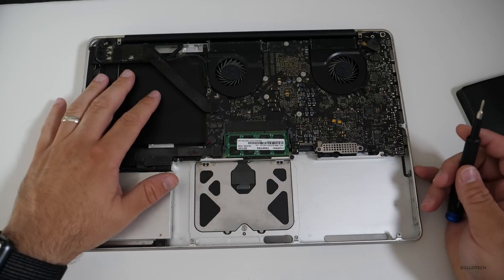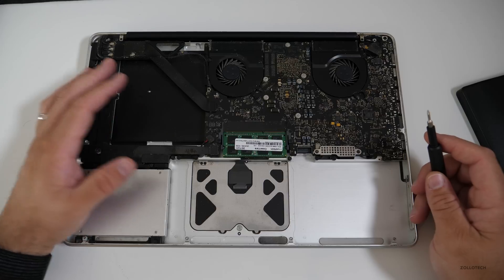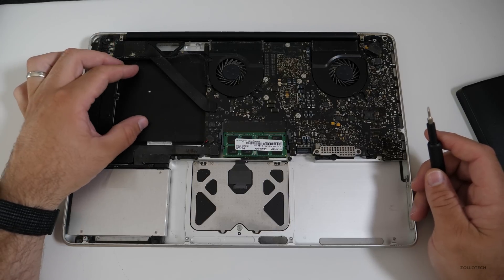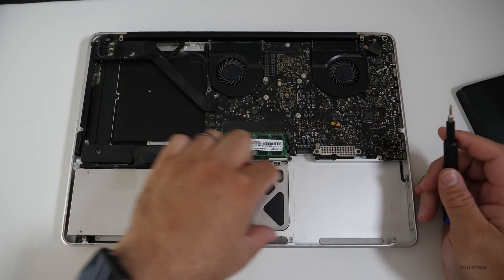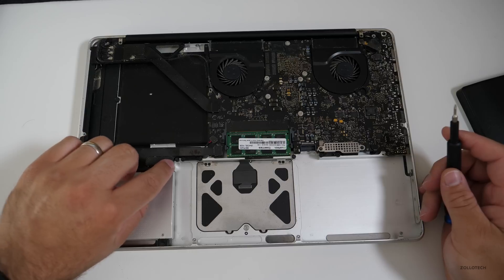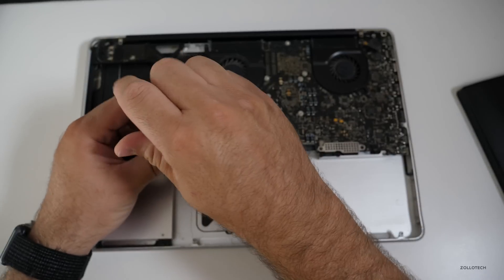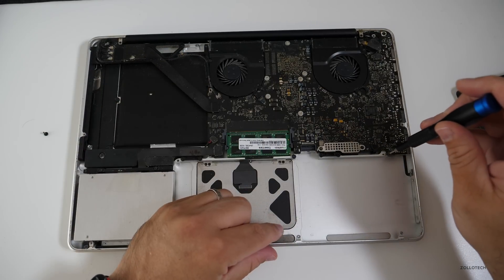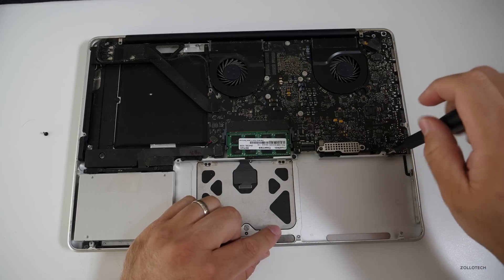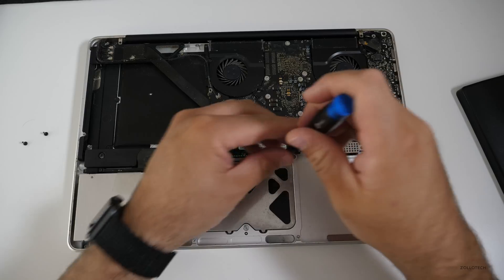The cover's off the bottom. You'll see it's a little bit dirty. It's missing the SuperDrive, and that's because it stopped working some time ago — we're going to replace it with a hard drive since we're not really using disk drives anymore. Right here you'll see this is where the battery went, and there are two Y0 screws that were holding the battery in place, plus actually a third one right here.